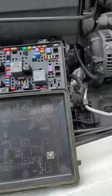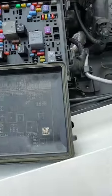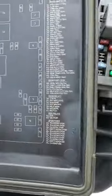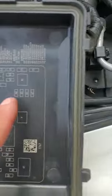Pull these two tabs and pull this up to access your fuses. Match your fuses and relays with the diagram on the cover. You're gonna look for number 42, which is your exhaust valve — right there. It's a 20 amp fuse, and you're looking for 42, which is right here.